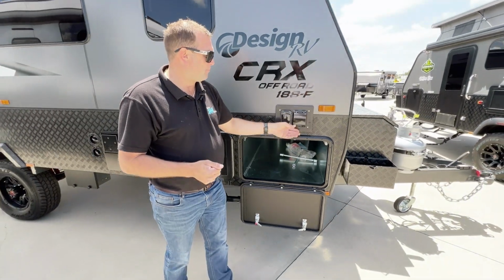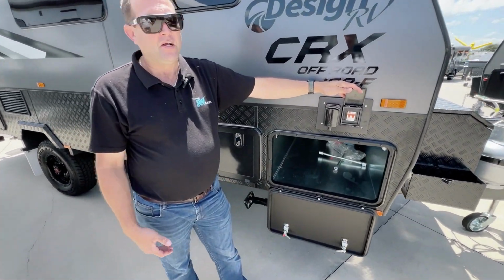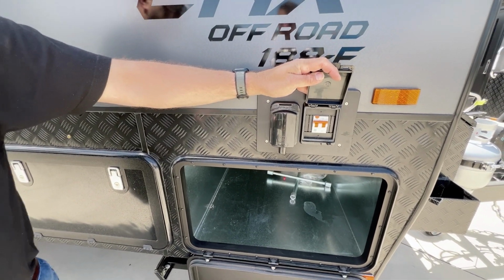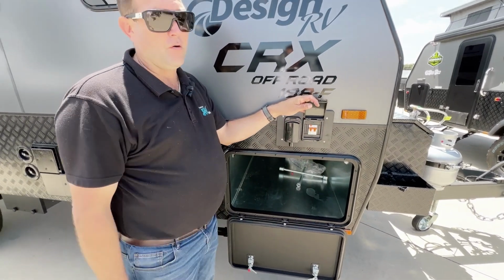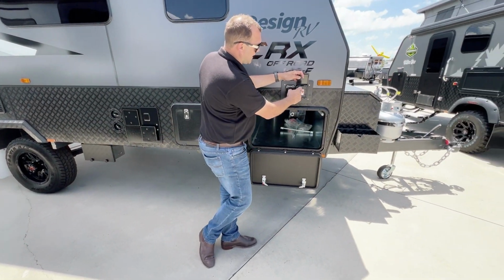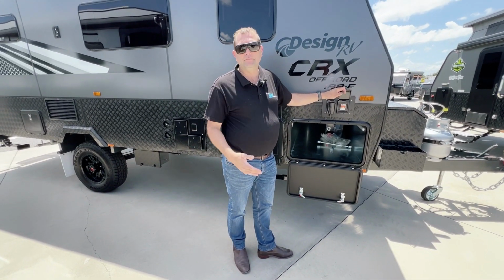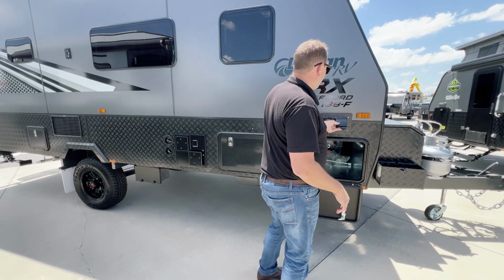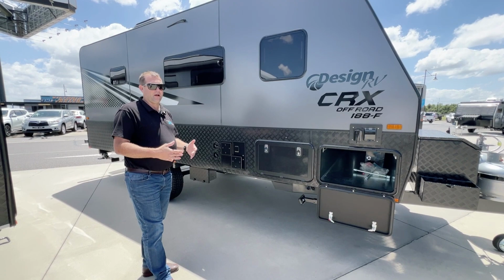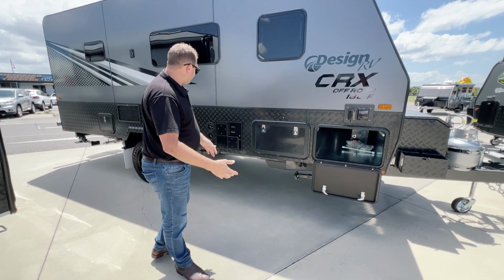Now beside that, you will see there is your safety switch. What I recommend with people when we do our handovers and discuss that, we test that every time we put 240 volt into the van. Test it. All you have to do is press that test button when you've got 240 volt plugged in. If that trips, it's working. So that is a safety part of the van. So we do have a safety switch.